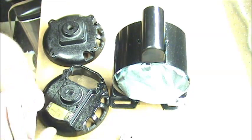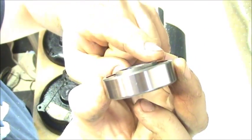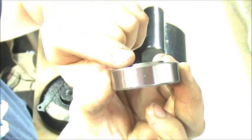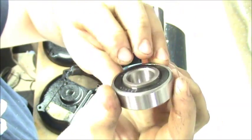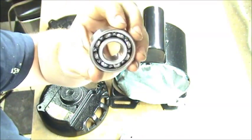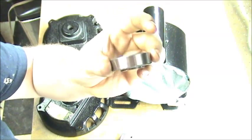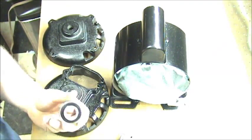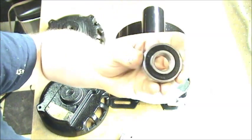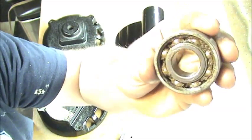The part number is 8504 on them. What's screwing you up is this raised portion on the back. Here's the bearing surface with the carrier, and here's your bore which is flat on one side but raised out on this side — that's what makes them hard to identify. You can still find these at automotive stores, but they want about 20 bucks a bearing locally. I found a company in California that sells them for nine bucks each.